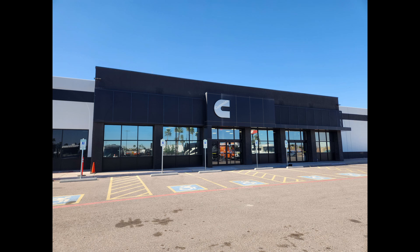You might ask what Cummins actually did to make this work. You take it to the dealership and they hook up their computers. First, they did a physical inspection of the engine and transmission to confirm it was mechanically sound. They ran diagnostics on both the engine and transmission computers, then reached out to the Cummins manufacturer for approval. Cummins sent the dealership a flash code, and they flashed the engine — just a software update — going from 380 to 450 horsepower. That cost $360.